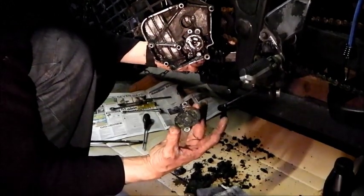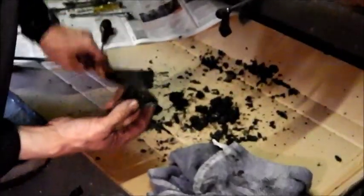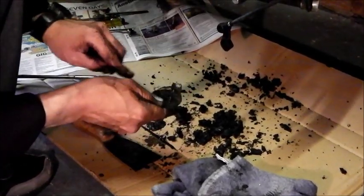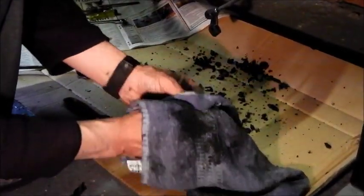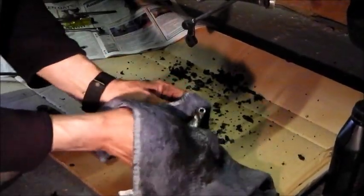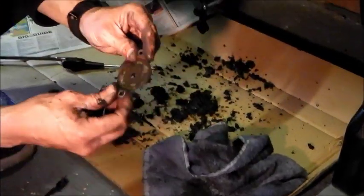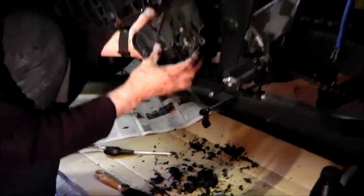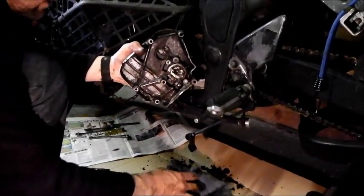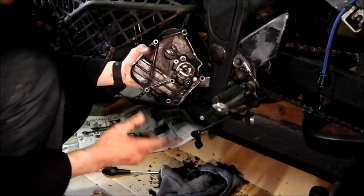Now that plate is removable. That's the retaining plate that fundamentally just holds the piston from coming out completely. While you've got it in your hand, give it a clean off. It goes without saying that all hydraulics have to be meticulously clean, so before this gets reassembled all that's going to be properly cleaned up. I've still got the system connected - I'm going to put a towel underneath just to protect there so that it doesn't pop out all over the garage.